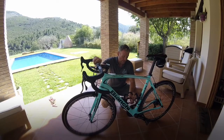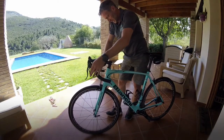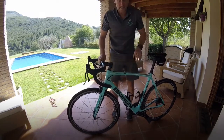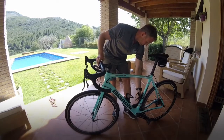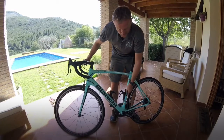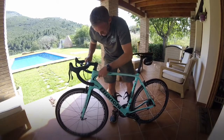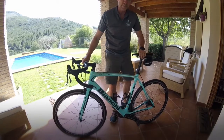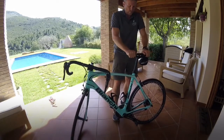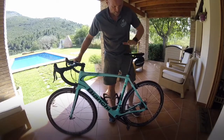Okay. This point here now we can check the front derailleur. So, change gear, is that moving? Yes it is. Moving up the frame, up the centre of the M, again checking the frame for any damage. Check the crossbar, any damage on there? No, we're not. Okay, so we're at the seat, so grab hold of the seat, give it a good pull, give it a twist, see if that's tight, not loose, no. Okay, that's in firm as well, so your seat's good.